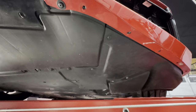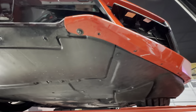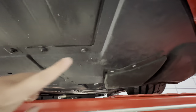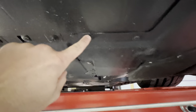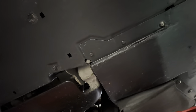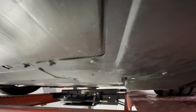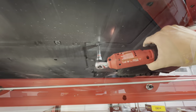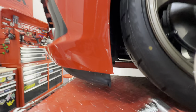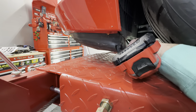The first step is to remove the T15 bolts that are here. These have already been removed because I removed my front lip, but you're going to want to remove any of them that hold this plastic panel in just below your radiator. We're going to remove all of the T15s and then there are some 7mm bolts as well. We're going to get under here and remove all of those clips. You'll also have two inside the fender well, directly behind the air dam.